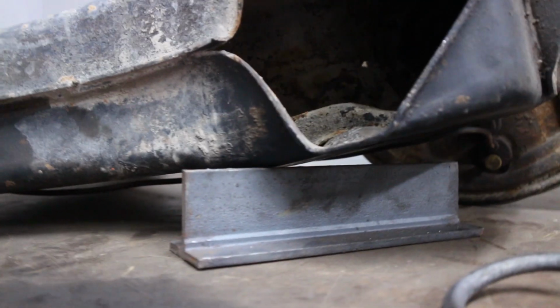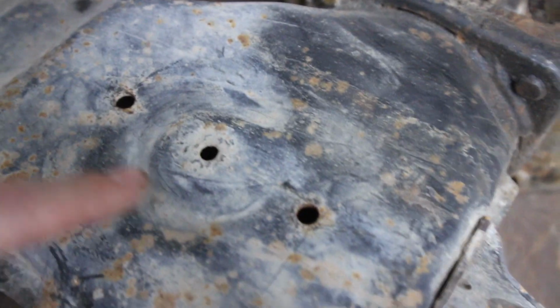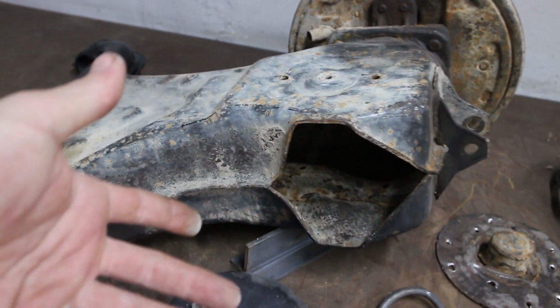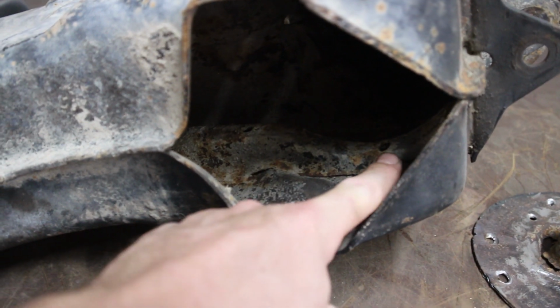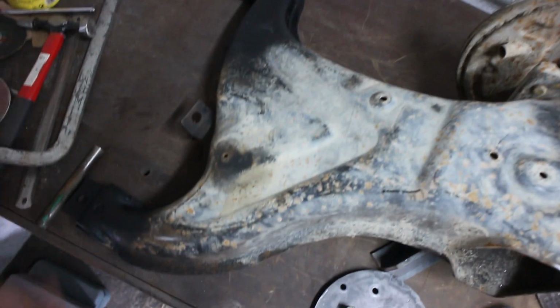I use the other side of the swing arm because that's probably stronger than the rusted old one, but those are all the same. Those are pressed together, but the top is the same shape as the bottom, so you could theoretically flip it upside down and use it for the other side, but you have to focus. This is the bracing for the spring plate side, and there is none on the other side, so you have to drill it out and flip it upside down. But that's a neat solution when you ask me.